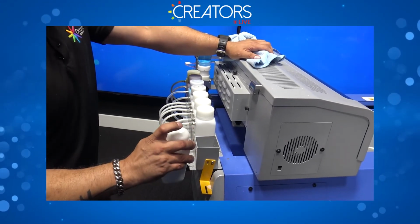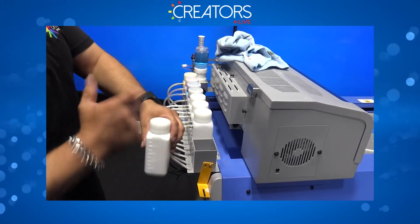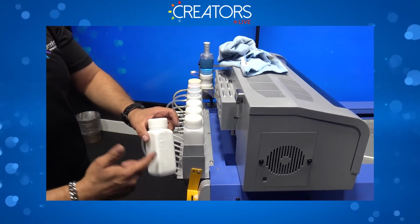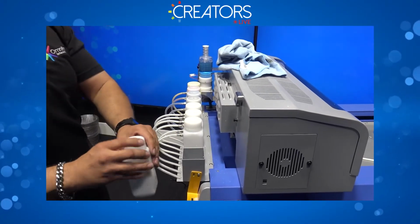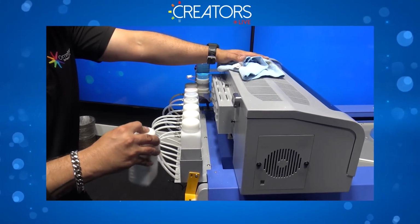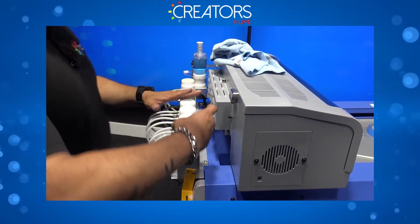Don't shake them. Sometimes I've noticed that people cover the hole and then go crazy up and down. Don't do that, because you're going to create a bunch of bubbles that, when you're priming the line, are going to be sucked into your lines and give you faulty prints. So the fewer bubbles you can create, the better. That's why I'm saying just swirl it instead of shaking it. You do that on all the whites.